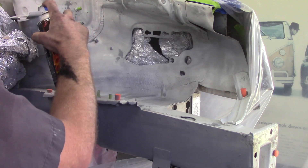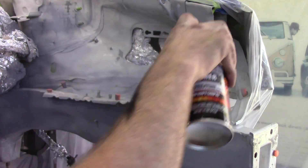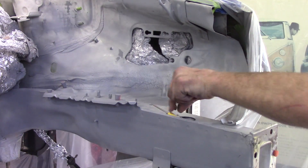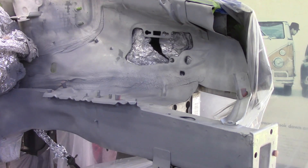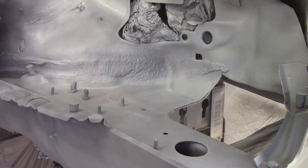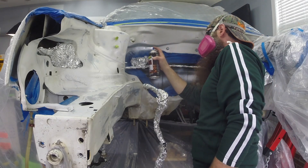Make sure you overlap the strokes by about 50% to get a good even coverage. When it comes to the process of using primer versus not, and using clear coat versus not, it's always best to follow the instructions on the can of paint you're using. On the driver side I did do a primer; on the passenger side I didn't — I wanted to see the long-term difference between using primer on one side and paint only on the other. I did not clear coat any of this surface. Most paint manufacturers recommend one or two light coats and then one or two heavy coats of paint. After priming, I did two light coats and two heavy coats.